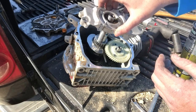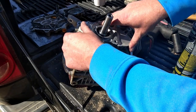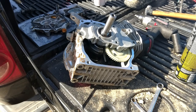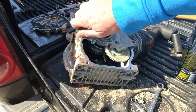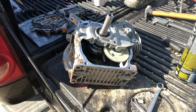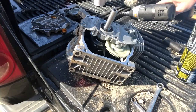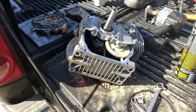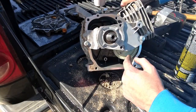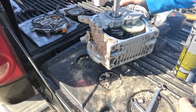The reason we did that — we can slide this back on, let that cam go in, just like that. Take two of your side cover bolts and just put them back in. And what that does is, when we put the new cam and everything in, you can see up top and you can see down below here. You can get a look down inside there and see what's hitting what and where you need to do your clearancing at.